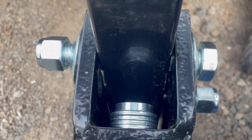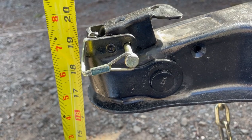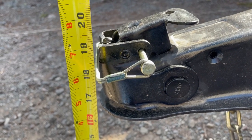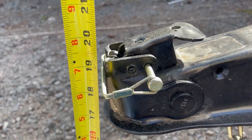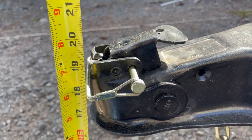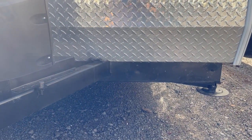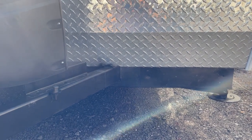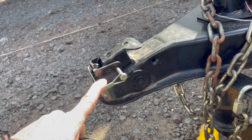We're going to get the fasteners snug — not torque them all the way down, just snug. When you set up your hitch, you're going to want that ball at 18.5 inches, or at most one inch higher than that — so zero to one inch higher. Always make sure the camper is level. I'm not quite on even ground here, so I measured from the frame to the ground to make sure I had the orientation right before taking this measurement on the hitch.